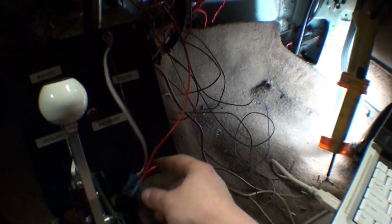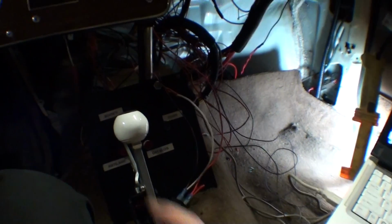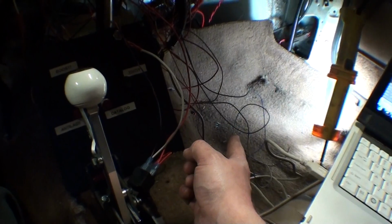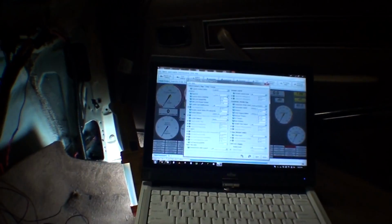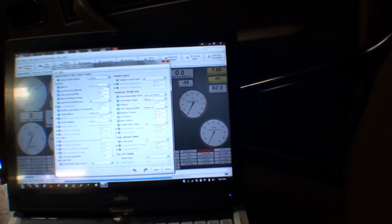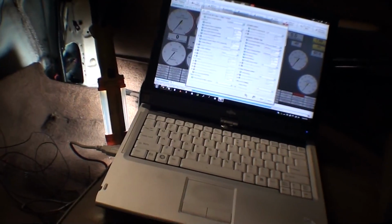And what's crazy is I still have a nitrous number 2 output, and I still have a thing called table switch where I can do other things, and then there's a bunch of other wires I'm using for inputs, so there's still a whole lot of things available, but I hope that gives you some info here on how I wired all of this in. I think I'm even going to draw a diagram. Some people ask me, but it's super easy. It's 2 wires going into the computer, 2-step in, and then nitrous out, and then nitrous in to activate the bump. And then the rest of it's just simple wires in and out of a relay. And then some programming over here, and then get the car right, and that's it. And I still have the content sensor and fuel temp and oil pressure and everything else already set up. So all of that's working in unison.